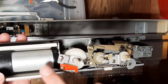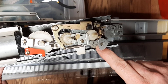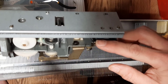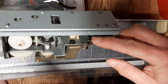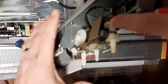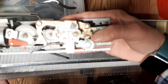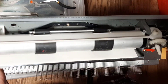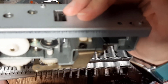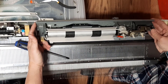Now you can see the three dials that you turn. This part is seized on the machine in question. You access that little cog with this little spring right here. All you have to do is remove the spring from this little notch and then this little cog comes up. If you've never seen the inside of a Singer 360 patterning device, there you go.